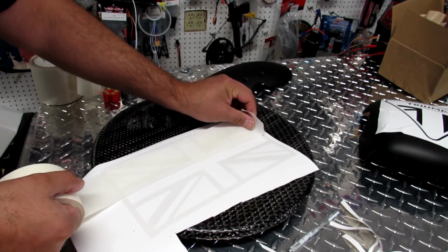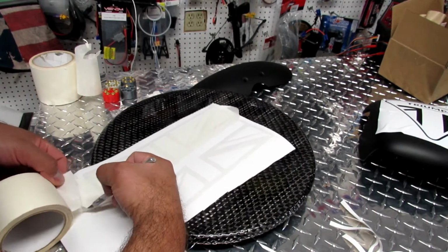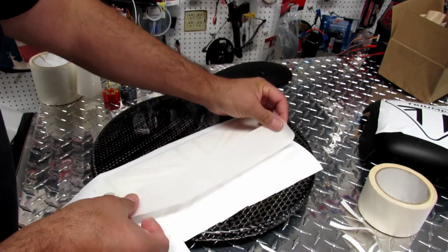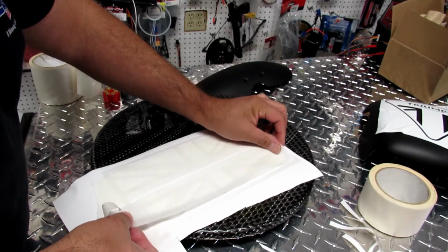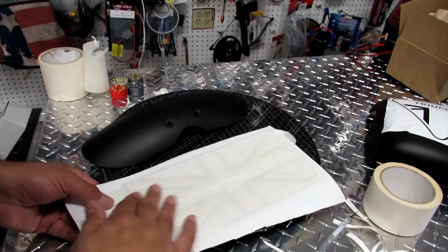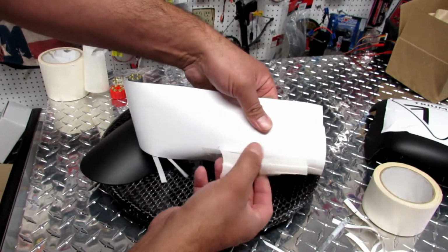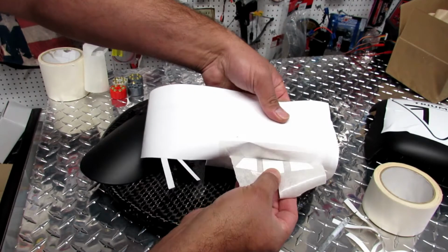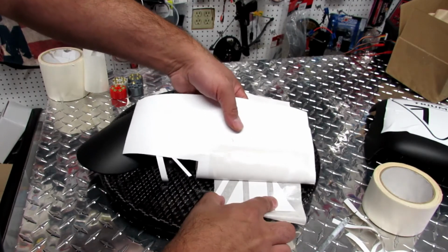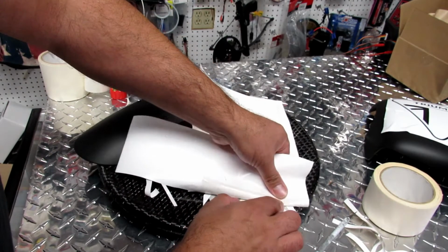So we're gonna grab this. You can cut it very rough, it doesn't really matter because it's only application tape. Then we apply it here, and now we're going to transfer it there. I'm going to show you the trick. You need to lift your graphic, so make sure everything is set up right, and you're going to start peeling it up gently and make sure everything is coming out. If something stays, just help it, just remove it.